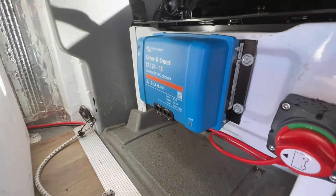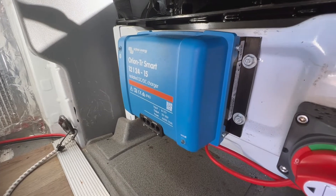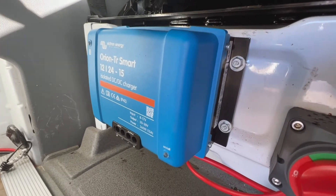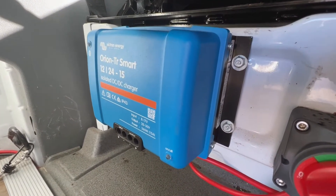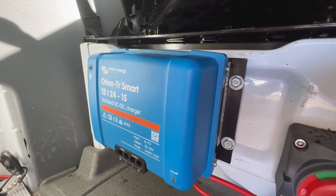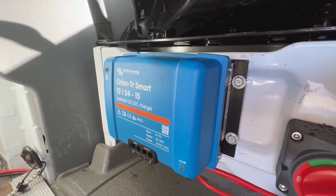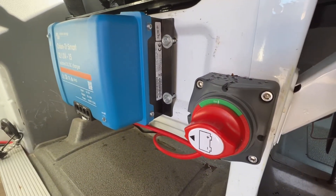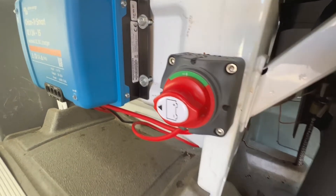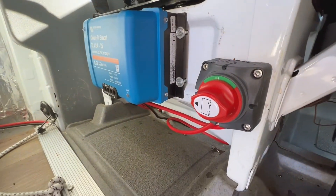Going into the DC to DC charger: when the van is running and our solar battery is dead, it will charge from the alternator and go straight to our solar battery. And if it's full, it just shuts off and doesn't use it. It also has a mobile app, which actually sucks and keeps unpairing from your phone. But it's so nice to have. Once you're cruising, it'll fill up the Yeti in not even an hour probably. I also put a kill switch on there because sometimes when I just commute to work, I don't want it to keep charging and non-charging the battery. I can turn this off and on so we don't have to use it at all times.